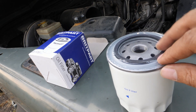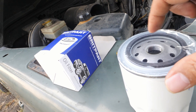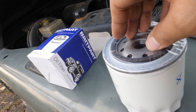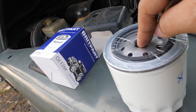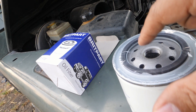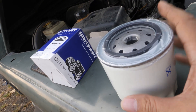The correct one is if you want to prime it, then you have to fill it in from this smaller hole here — not from the middle hole. Why? Because if you put oil in the middle hole, then you have a chance that you're actually putting unclear or not-clean oil in, and then later on it can damage your engine. So if you want to prime it, use this oil only. Plug this off and then pour the oil here, filling it in from this hole. So that's the correct way of doing it.